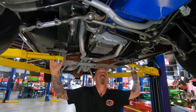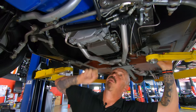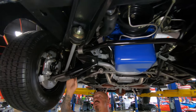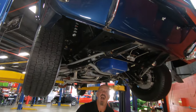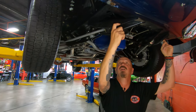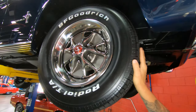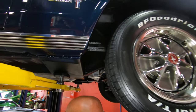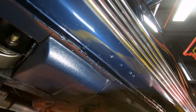We're going to have a 66 model C4 transmission — I almost said C6, but it's a C4. It's got the little pan; the C6 kind of looks like Texas. We've got a stock appearing bell housing, power steering, and disc brakes on this car. The lower control arms look new, brand new bushings on the sway bars, upper control arms also look new, flex lines are new, and the radius arm bushings look new. These braces where the radius arms come in — normally these are all bent up because guys have been jacking up the car over the years, but these look great. The tires look brand new; the style steel wheels are looking sweet. These are 205/70-14s. Working your way down the pinch weld — see how nice and clean that is, how tight it is, the bottom side of the rocker molding all painted and looking sweet.